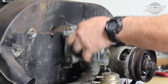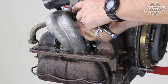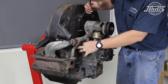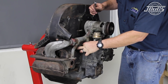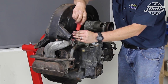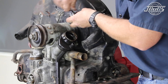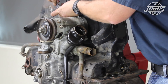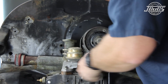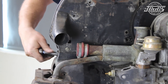Now the carburetor is removed from the intake manifold and the generator strap is loosened from the stand. The left and right intake manifold nuts are unthreaded from each head and the intake manifold center section nut is loosened at the center of the case. The intake manifold boot clamps are loosened so the left and right intake manifolds can be removed from the heads. Next, the four bolts for the generator backing plate are unthreaded from the fan shroud and the four nuts for the generator stand are unthreaded. The left and right fan shroud to cylinder shroud bolts are removed from either side of the fan shroud.